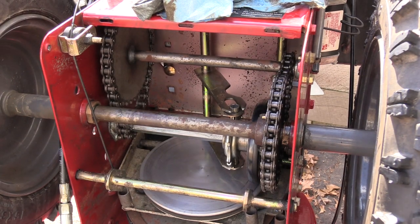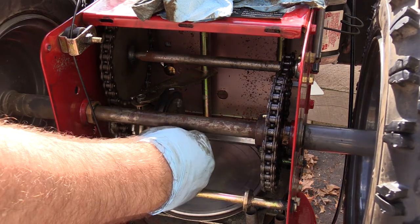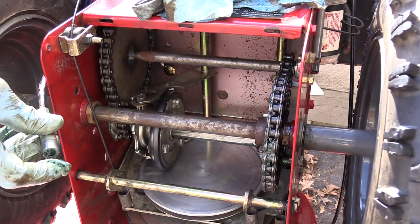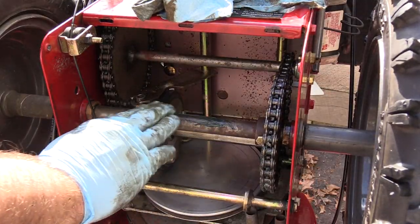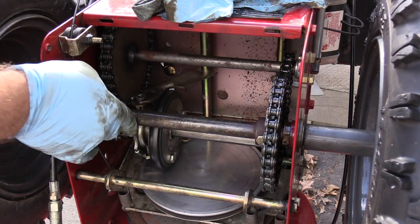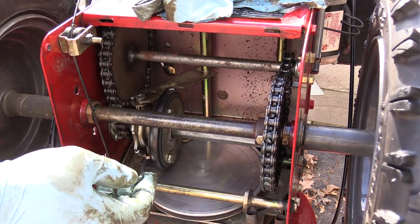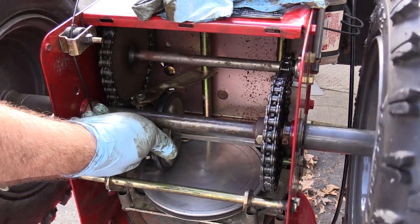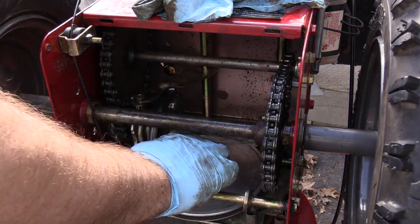This doesn't have to be super tight because it's got that plastic insert so it's not going to come loose. You don't want to warp the hub. Getting some grease on those surfaces — not a lot, just a skim coat. You do not want grease on the friction surfaces. Shifting into second reverse and doing the same. A little more grease here and there. If this lasts me a long time, no reason to replace it — I can fix it again. The chain feels a little loose but that's the way it is.